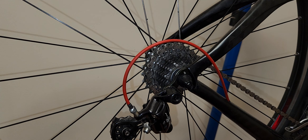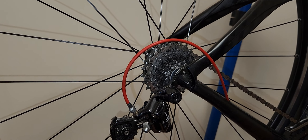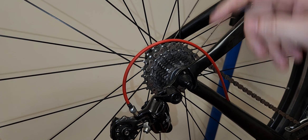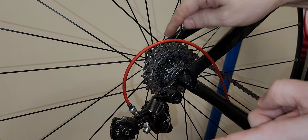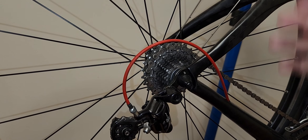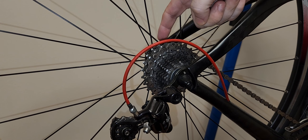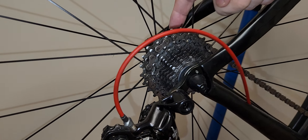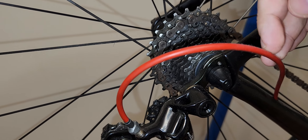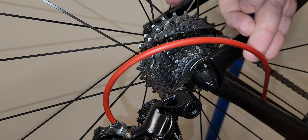So here is my Pinarello. I've been testing it and I'm going to try to see if this derailleur is going to move the chain further back from the very last cog. Basically, I'm trying to see if it's going to stop on my biggest cog here — this is the very last one that I want it to stop right there.